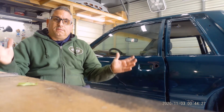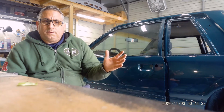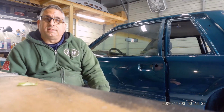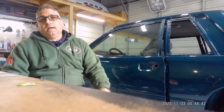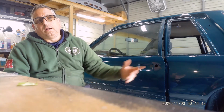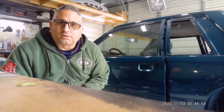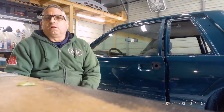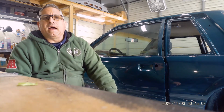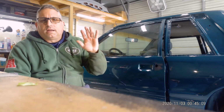I didn't do a scuff and paint quickie paint job, but I also could have done a little better with the sanding and the blocking and stuff like that, because it just made it harder for me to polish. Instead of just getting the buffer and polishing out 3,000 grit scratches, I polished this car for 2 days. 2 minimum 8-hour days. And then wet sanding and re-wet sanding. You guys know the story.